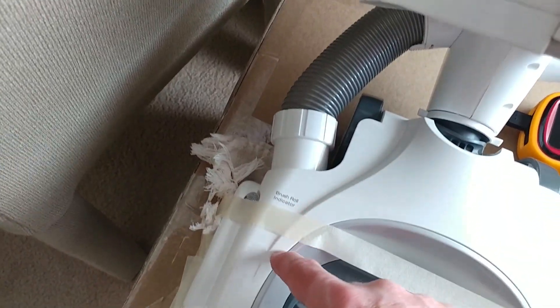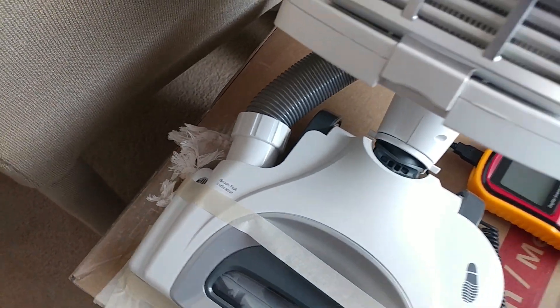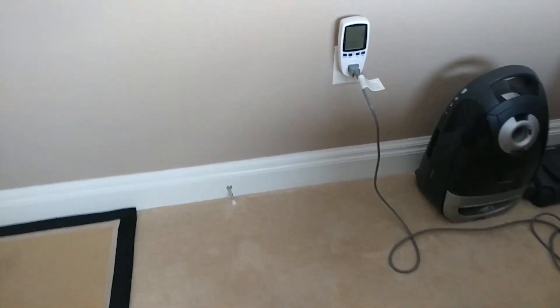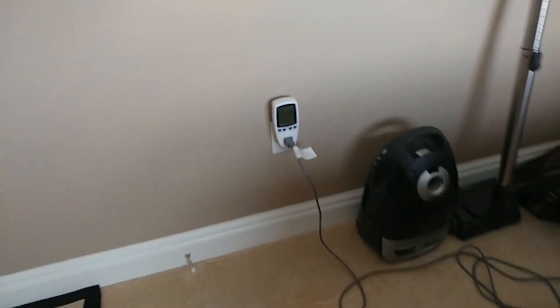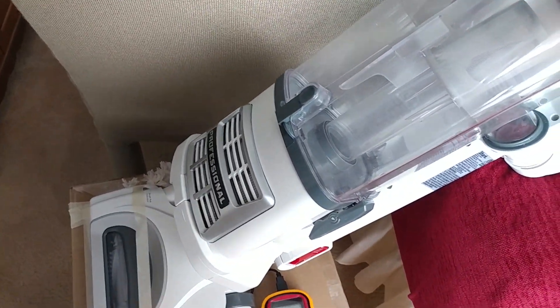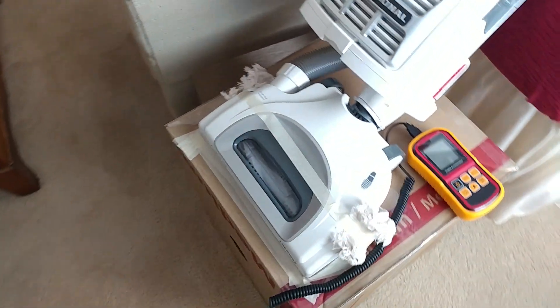Right here where it goes to the input of the power nozzle, about 65 CFM. Now the voltage here is much lower than what I have at my normal lab. We start out at initial conditions here about 117 volts, dropping to about 115 under full load. So if you want to know what this thing could really do, take 121, divide it by 115, and raise the result up by that proportion.